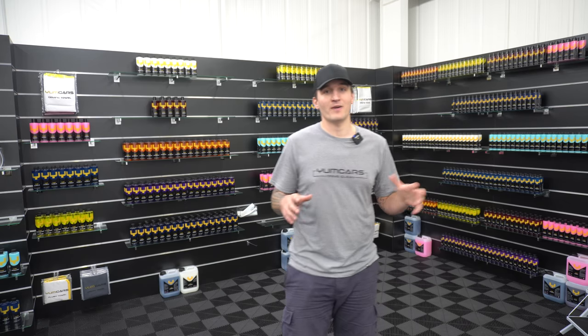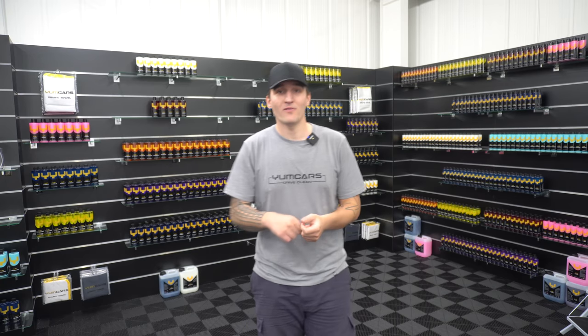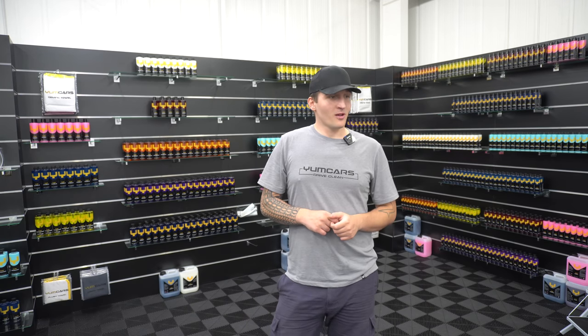As I said, if you've got a normal stock engine bay, you're going to be totally fine. Now, if you've got an aftermarket engine bay, so you've got exposed air filters, nice and easy, you just bag them up. Or in some cases, air filters, you can unscrew it, put it inside and stuff a few utility towels, plush towels into the hole, or just bag it up, tape it up, and you're fine. I've done a lot of aftermarket engine bays where that's exactly what I've done. Everything else is still splash proofed, and every time your engine bay is going to look great.